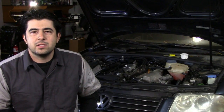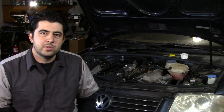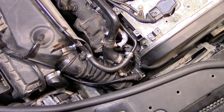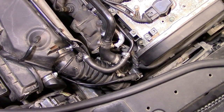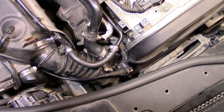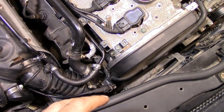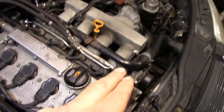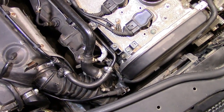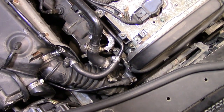Today, as promised and as a follow-up to my 'how a turbocharger works' video, I'm going to show you how you can make a boost leak tester to check for any boost leaks on your turbocharged engine. The whole idea behind checking for boost leaks is that you want to introduce compressed air into the compressor side, make a closed system including all the hoses and piping that carry compressed air from your turbo to your intake or throttle body, and then listen and look for leaks.